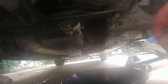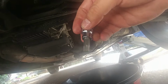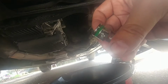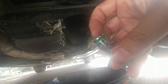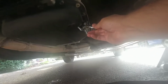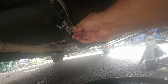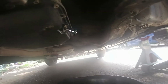All right, special tool alert. You will need this. I have one I bought at AutoZone, Duralast T50. And then there's 76-013. So I guess it's a T50. That will go right in there, and that's for the transmission. Okay, special tool alert. That's the socket. Put that under there and we'll get 4 quarts out. That's the test.